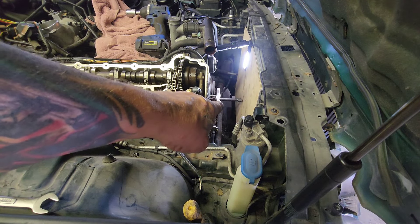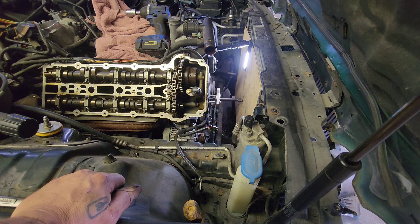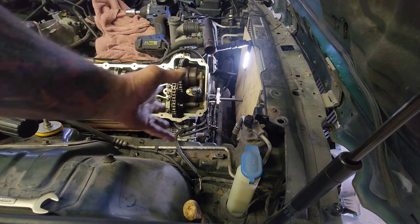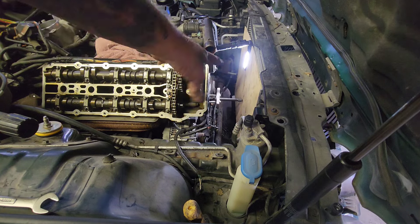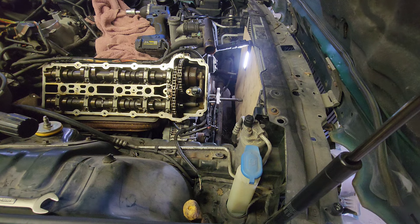If you look right down there, you'll see my puller is on there. There are two bolt holes in that pulley — one of mine stripped out when I first tried to pull it. I had to get down there with a tap and tap a new hole and use a larger bolt on one side. I was really cranking on that trying to get it to break loose. So what I'm doing: I'm spraying it, I'm putting it under tension, I'm going to tap on it, put a little more tension on it and just leave it. Because your project car shouldn't piss you off, and this is really starting to get on my nerves. I'm glad I got the bolt out. I'm glad I had a tool half made for that — now it's custom made for this. I really hope that everything's fine in that head, but that's all yet to be seen.